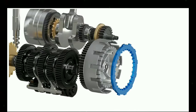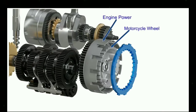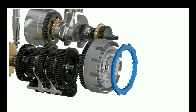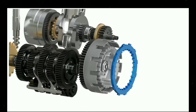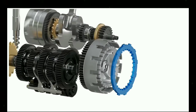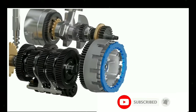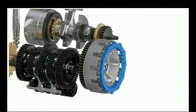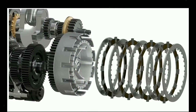But there is a problem in using this connector. When the connector is removed, the inner hub spins due to inertia of the motorcycle rear wheel and the outer basket spins due to engine power. This is why these two components start spinning at different speeds. In order to interlock with both of these non-synchronized spinning components, the hypothetical connector will have to spin at two different speeds at the same time, which is impossible. For example, if it matches the inner hub speed, then interlocking this connector with the outer basket will be either impossible or too difficult. To eliminate this problem, the clutch pack is used in place of this hypothetical connector.